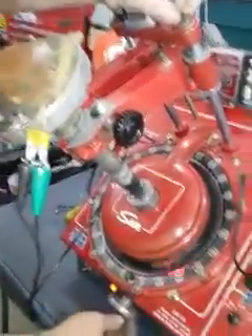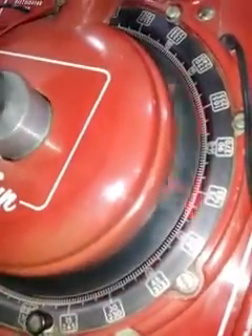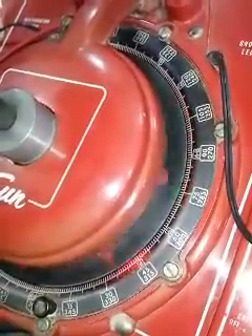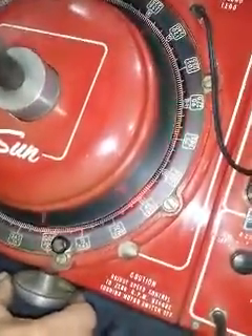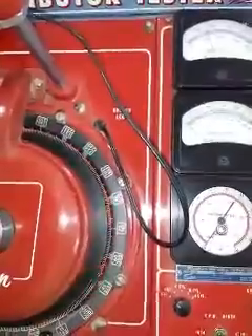So we've got a signal now with no advance. You can adjust your ring up — there's no advance happening there yet. Bring it up to the RPM. It's about 5 degrees. We've got a thousand RPM. It's about 12 degrees. That's 1,540 RPM, it's about 15 degrees. You can see the bars jumping around a little bit — it tells you that you're pushing for a little more on the distributor.